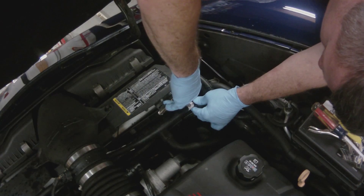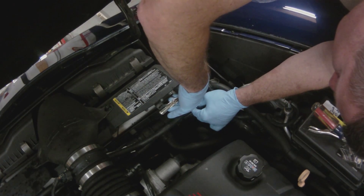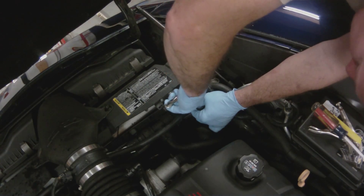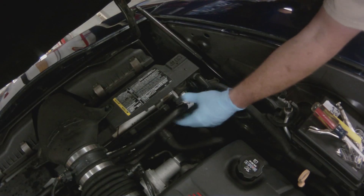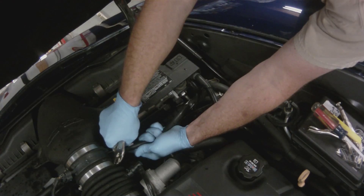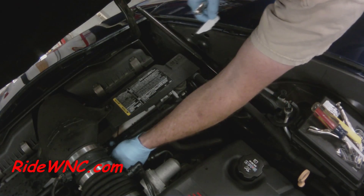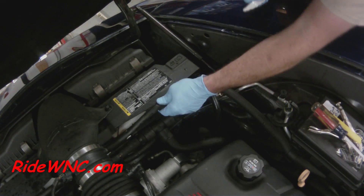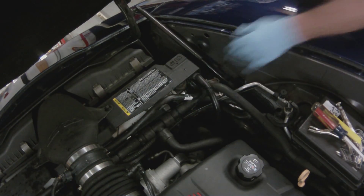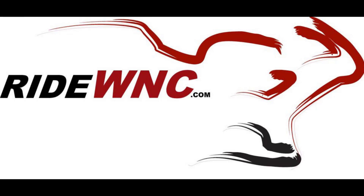I would go ahead and replace this hose if you have 150,000 miles on your car — this could be a point of failure. It could leave you stranded if your car overheats, easily pumping all your coolant onto the ground and leaving you stuck without any coolant. But it's pretty easy — just a few minutes to replace this hose and you're back in business. Thanks for watching and enjoy your Corvette.